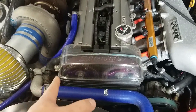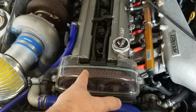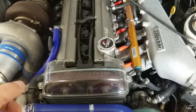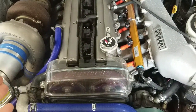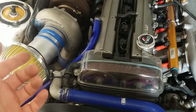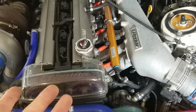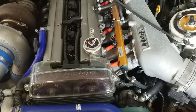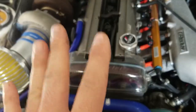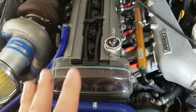And I say that's all, but in perspective for how much this would cost, it really is that's all, because building one of those probably costs you about 12 to 20 grand, depending on if you're paying someone or doing it yourself. A turbo is probably going to set you back, for a cheaper turbo like 3 grand, more expensive turbo like 6 grand, and then the fuel injection system will probably set you back anywhere between 2 and 8, depending on how crazy you want to go. But with all that, once it's tuned, that should easily make on E85 about 1,000, pretty easy.